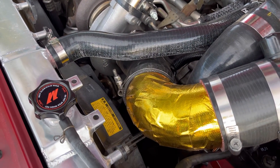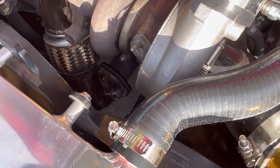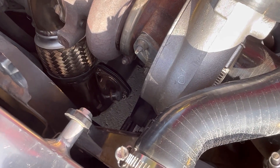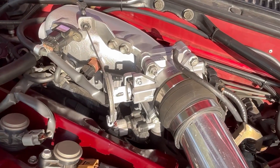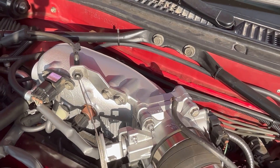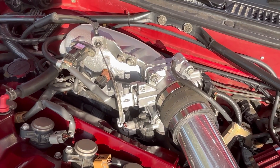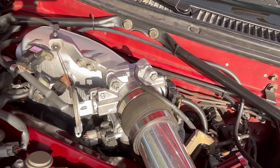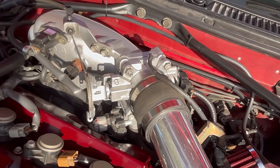The next thing is the dump pipe — the OEM pipe does not fit because the dump pipe is three inches and I believe the OEM was like two inches or 2.5 inches. Either way it doesn't match, so you have to take the car to a shop and have them get a fix for you. Also, the throttle cable bracket had to be custom made because the OEM throttle cable was too long and had a lot of play. I had the throttle cable zip-tied to a sensor for a while before I got a custom bracket made so the throttle sits properly without any play.